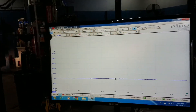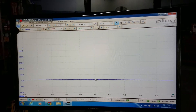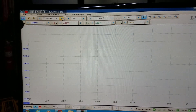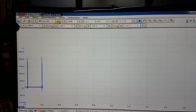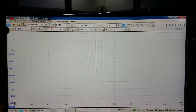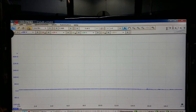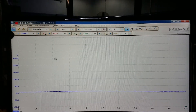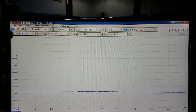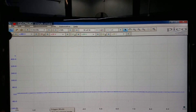You can see the signal is moving around — that's because of the time base, which we talked about before. Usually we have the time base ramped up quite a bit, but for the sake of this video I'm going to reduce the time base so we can see the waveform more clearly. Since it's moving around a lot, we're going to need a trigger.